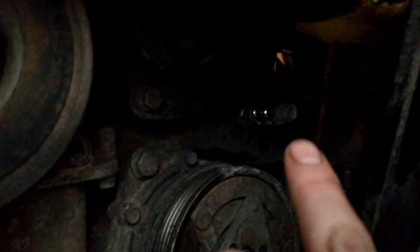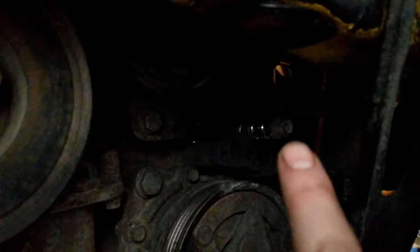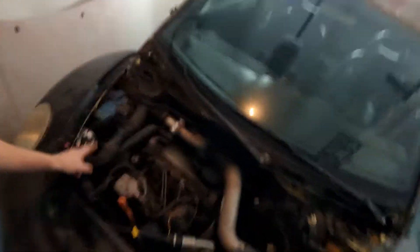And then this Beetle — I was just driving it and I'm actually going to make a DIY video on it. You can see that little stub sticking out — that used to be an idler pulley. The serpentine belt goes around all these pulleys and that's just an idler. I heard some marbly noises while driving and suddenly lost power steering, and obviously the alternator and AC — though that doesn't work anyway. I was able to get home on battery just fine since I wasn't far out. I just need to go pick up an idler pulley, unbolt the old one, put in the new one, and re-wrap the belt around everything.